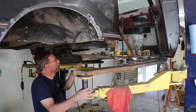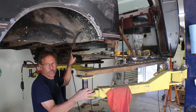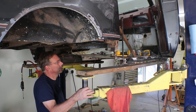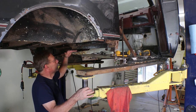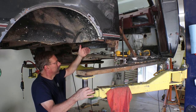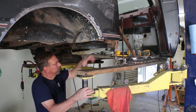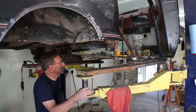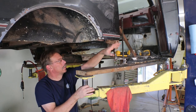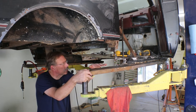We got all the rust out through here. There's one hole right here on the inside panel, so before I fill this I'll put a piece of copper behind it and weld through to just fill the hole. To do it right you just keep going until you get to some clean metal. We have a nice pretty straight edge here — we can build down on that panel, and the floor panel I'll just make as one piece with the L in it, then make the rib that'll go here for the body mount, and all that will piece back together pretty quick. It's really not that much material. The outer rocker will probably take the most time because it's got a step where the quarter panel comes down.